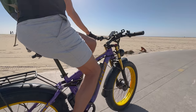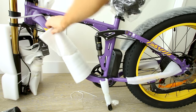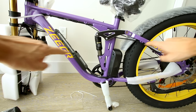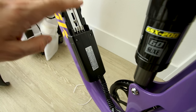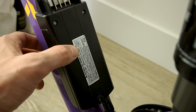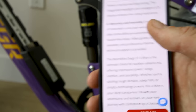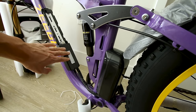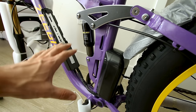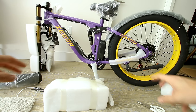Here is the controller box — we may pop that open later. The controller pulls power from the battery and sends it to the two motors. It looks like there's also a controller mounted built into the battery tray, showing 21 amps. Skimming the website, it's not entirely clear whether this is a dual controller or single controller bike, but looking at the power claims, this is likely a dual controller setup, probably 40 amps total.